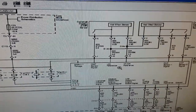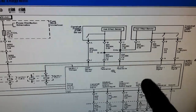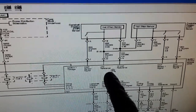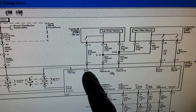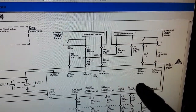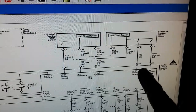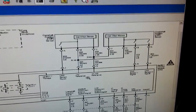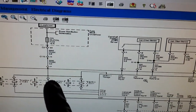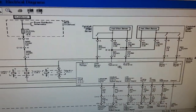If you're having this problem, make sure to check your 12-volt reference voltage going to your cam and crank sensors. Also check your low reference voltage, which is your ground. Last but not least, check your cam and crank signals. Your most important input is your crank sensor — your vehicle can start even with a faulty cam sensor. This is a dual crank sensor with a 3x and 18x signal, so without the crank sensor signal, you're not going to get spark on your coil packs. Hopefully this information is useful — please subscribe and like.